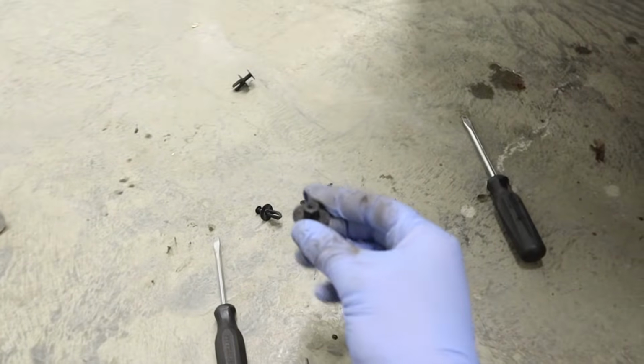down here now. And what all of this has done is allowed us to pull this inner fender well out, and so we can start to gain access back here. And I'm going to have to get this down and around, but basically we're going in there so that we can get between the fender and the front bumper. We've got to take 2 more bolts out up there. Let me get to that and I'll show you as soon as we get there.